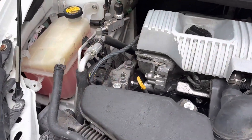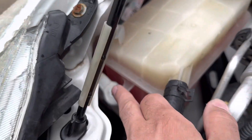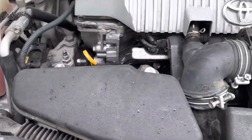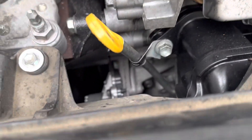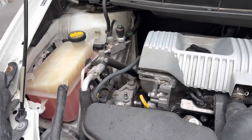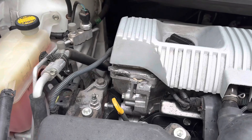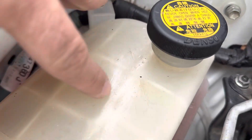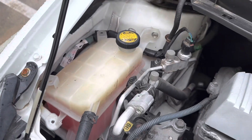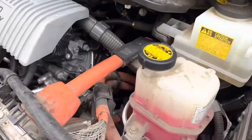We found leaking coolant down on the top of the motor mount. We looked around the cooling tank and noticed a cracked bracket, but that wasn't where it was leaking from. We pulled everything up — we had put a brand new water pump on it during the engine replacement, and it wasn't leaking from the water pump, which is what I initially thought. There was a history code for a coolant temperature sensor, and the only thing we saw was a little bit of blowout from the top of the radiator cap. She mentioned she had to top off the coolant.